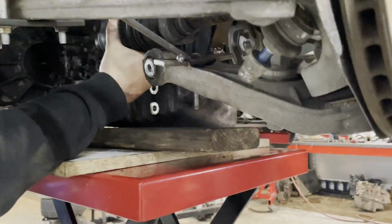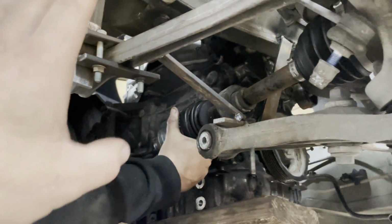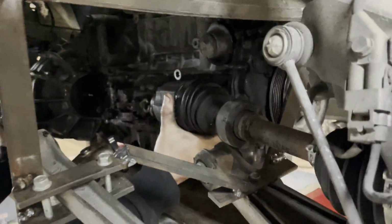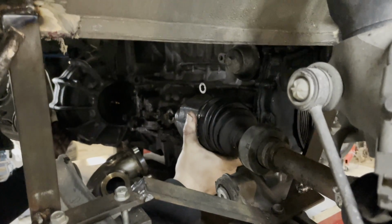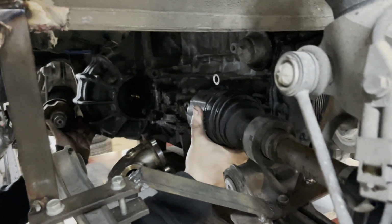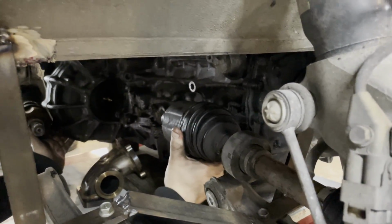Over on this side, we have what would be the new angle for the axle, and we've mocked it up so we can hold the suspension components in place without the subframe here, so that we can now test our axle angle. And it is no worse and maybe even slightly less aggressive than the original Porsche axle angle. Hard to see, but I definitely don't think the axle angles are going to be an issue with lining everything up. Either way, we're not too concerned about this axle angle. I think it's well within a reasonable amount.